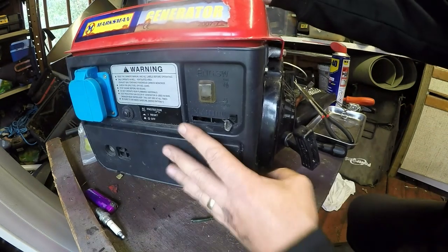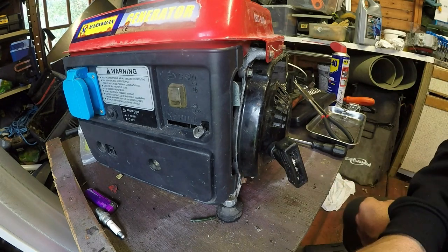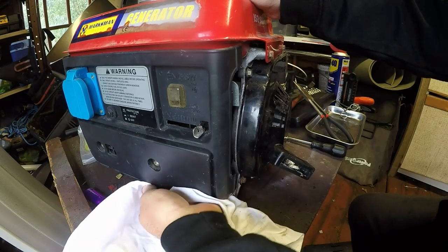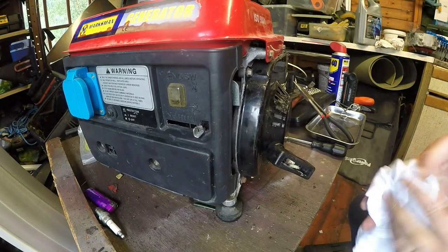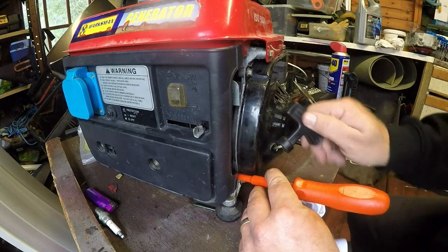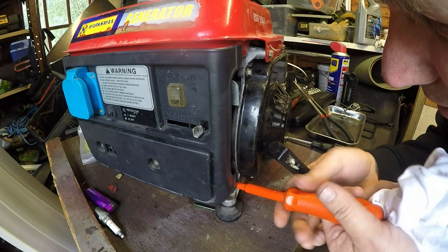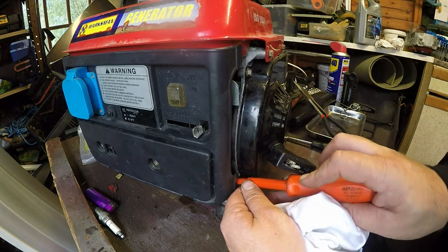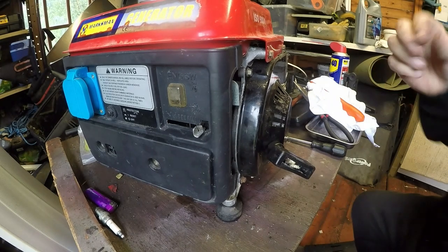Well, that's not showing any leaks, which is good. Just now I'll try and flood this carburettor by loosening off this screw, which is at the bottom of the bowl. And by unturning that I should be able to get some fuel down to the bottom of the bowl — so it should start to see fuel now dripping just here. You can see it. So that tells me we actually now have a carburettor that's now flooding. So tighten that back up. Happy with that. And we'll go for a little run up, shall we. Let's see what we can do.